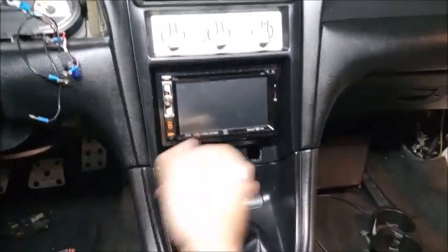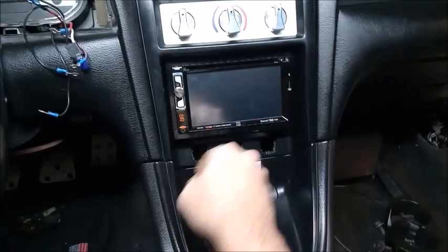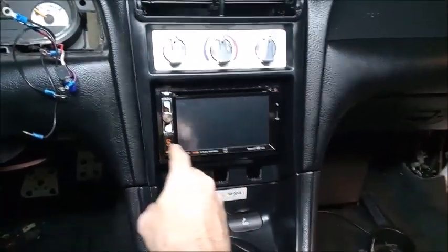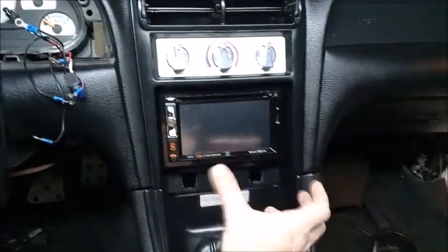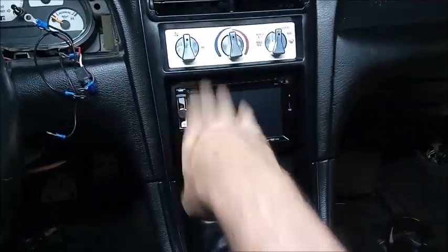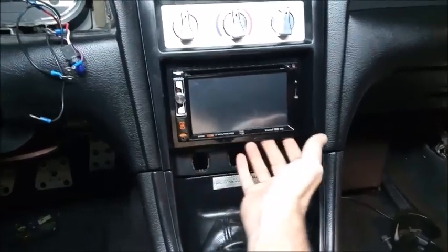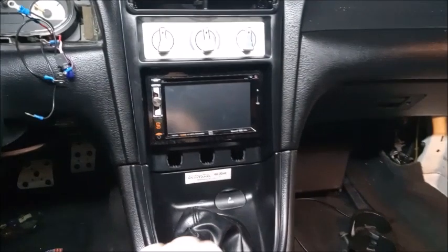Or it has pressure clips and the radio bolts to this piece, or people would just put a strip of aluminum or some sort of strap across, and there's no bracing in the back, no bracing on the dash. If you push the radio, it might flop around because the mount's so cantilevered, just mounting right here at the front on a piece of strap that's just kind of flapping around. So this is the way I did it.